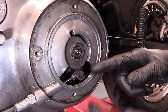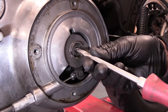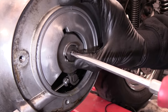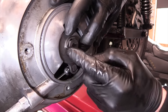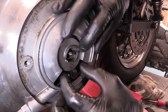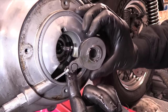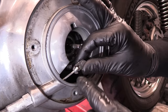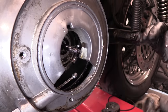There's a little three-piece mechanism here. You need to unhook the cable — that's why we backed all the slack out of it, so there's space to move. You start with the center adjusting screw, turn it clockwise, and that will start to bring the nut out. Once it comes out enough, you'll be able to unscrew it. With that nut out of the way, take the adjuster out, then turn it 90 degrees downwards and lift it up off the little hook. Then this little hook itself — it's just a boot that holds on to the end of the cable — push that forward and release it. There we are, that's your cable completely free to remove.